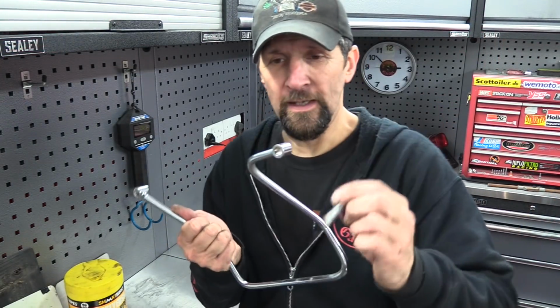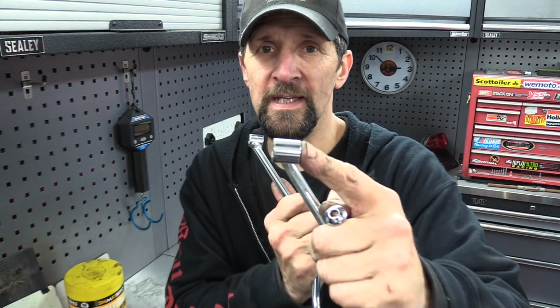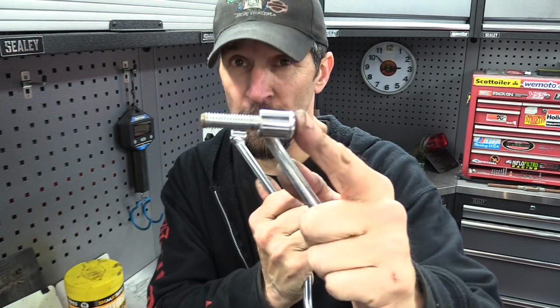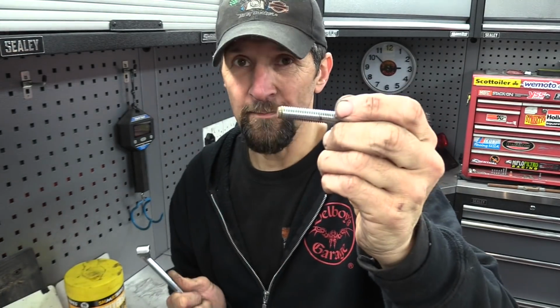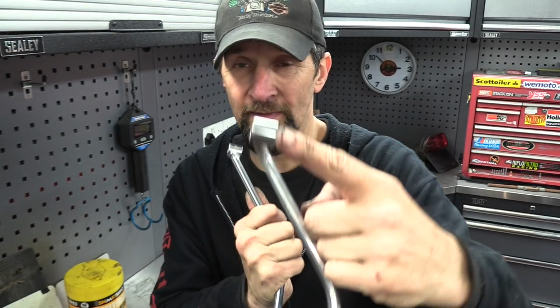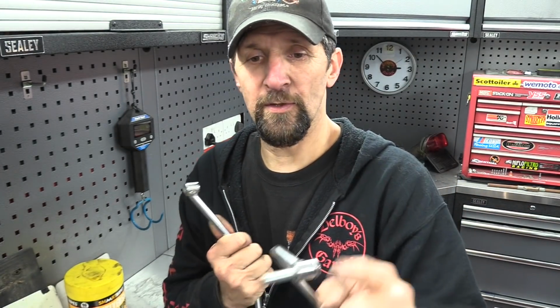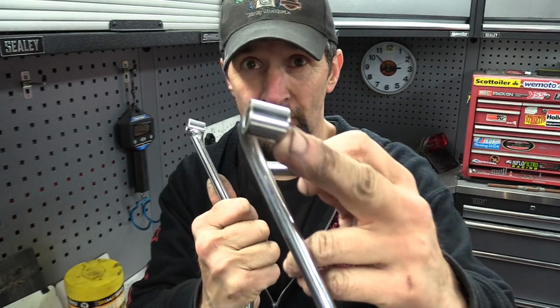Okay, got to cut some bolts down now. When these were mounted, these little lugs here, the bolts that held the rear fender on were mounted through them. Now I'm going to delete them. The bolts will be that much too long. They will stick into the fender inner area by that much and then interfere with the tyre. So in order to make sure it doesn't, I need to shorten all of the bolts that bolted through there by that much.